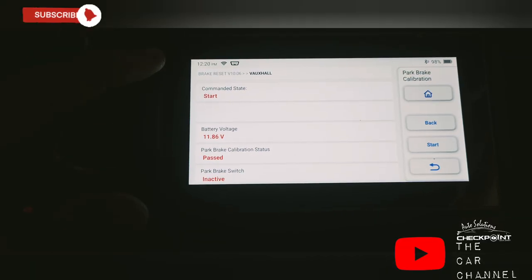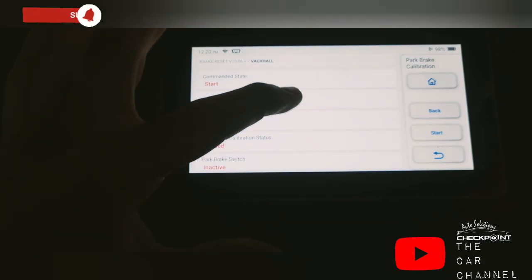There you have it, friends. That is how you fit discs and pads on a Vauxhall Insignia, and more importantly, calibrate the rear calipers whenever you put it back together again. A lot of folk would just say, oh, just use the button for it, but it's better doing it right so that there's no problems in the future with it. Maybe an imbalance, maybe binding on one side, at least that's calibrated and they're working equally. Otherwise it wouldn't have passed on the test. So it's now passed. And there we go.